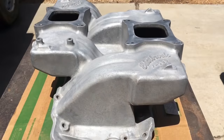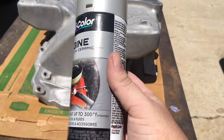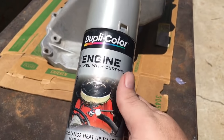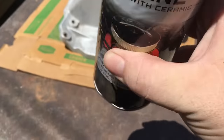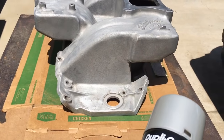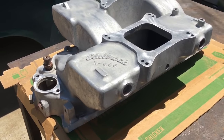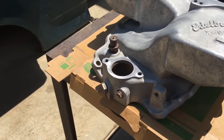Now that we're confident we got all the surfaces clean, it's time to paint. The paint we're using is Dupli-Color engine enamel with ceramic — this is what we paint blocks and stuff like that with. It's easy to touch up. This is the cast coat aluminum color; it's a little bit darker than this manifold would have been brand new, but I think it's a good color. If you want brighter, they make it in standard aluminum. Shake this up for a good couple minutes solid and then start with a couple light coats. The great thing about this paint is it flashes really quickly, so you can almost immediately apply your second coat.